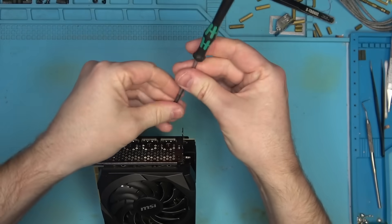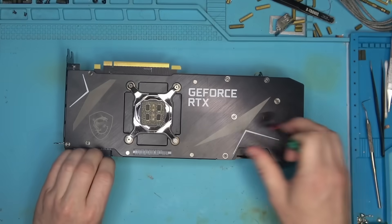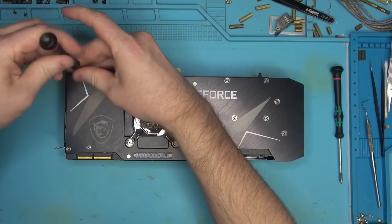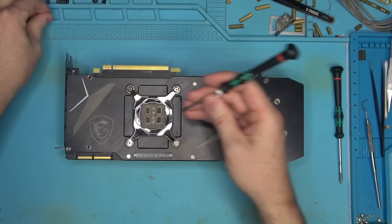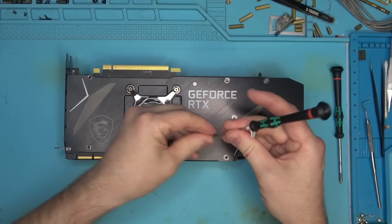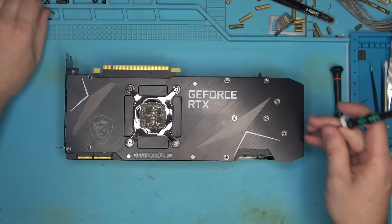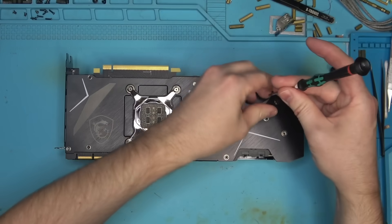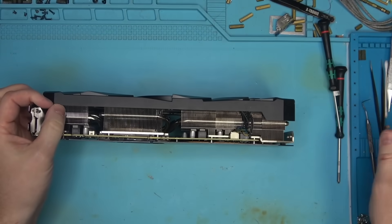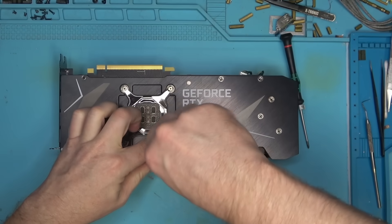To the customer watching this repair - to the customer of the previously repaired MSI Ventus that I fixed today - I want to show you what bracket you're missing. The customer with the exact same card sent it to me after it was in yet another shop. They sent it over and it was not fully assembled - some screws in a pouch, the backplate was on, the IO was on, but the bracket inside was missing. I'm going to show you exactly what I mean using this identical card as an opportunity. Let's disconnect the coolers and remove the leaf spring.